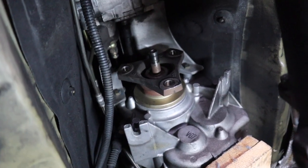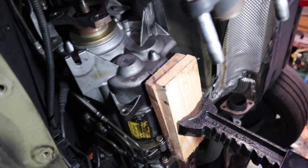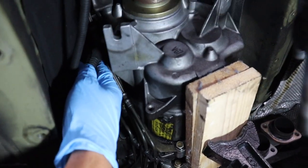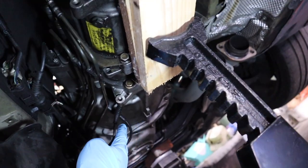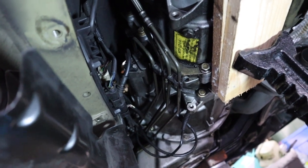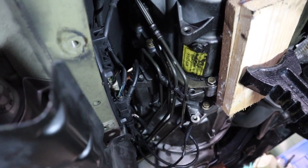So this is day two. I ended up taking all six of the nuts and bolts off of the drive shaft and took the flex disc off — it was pretty beat up. Now that's off and it's hanging here with this ghetto zip tie situation with a box underneath just in case. Next up is removing all the SMG electrical connectors, pretty much removing all the electrical connectors from the transmission itself. I'm going to remove all the clips from down here and the plugs and try to remove the SMG pump from above.